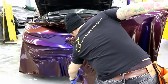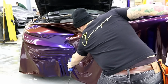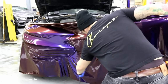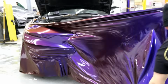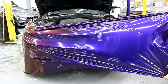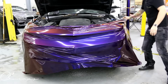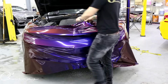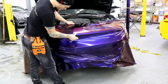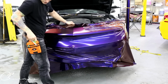Emphasis on contouring the bottom around because we need that to really give the bumper a good wrap. We really got to get the bottom coming around. Okay. So I think we're doing pretty well. So as you can see, the glassing is starting to take place.